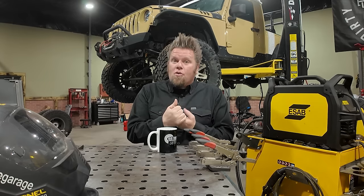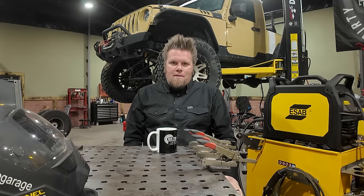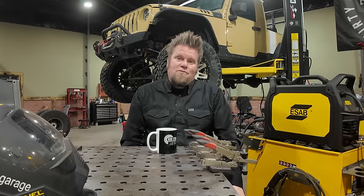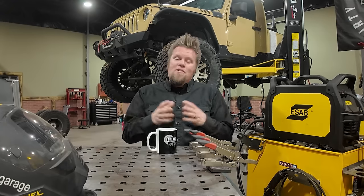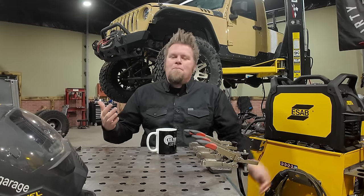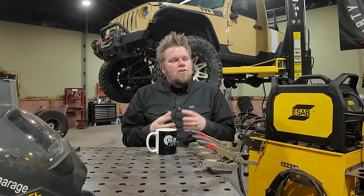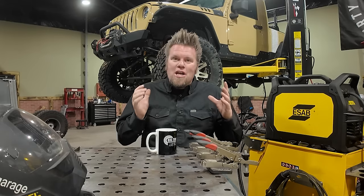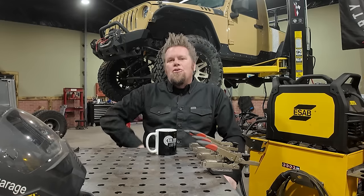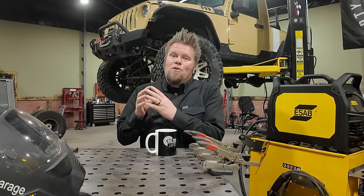Is your steering correct for a one-ton swap, or do you need to completely upgrade all the steering in your Jeep now? Obviously, you're gonna need new drive shafts at that point, so now you gotta get all new drive shafts for the vehicle. And then add to the fact that now that you've got one-tons, you're losing a little bit of ground clearance, you're probably gonna want larger tires, and then probably the most important thing is when you do that one-ton swap, those wheels that you already bought for your Jeep that you're in love with, guess what? They're not gonna fit on those one-ton axles. You gotta get all new wheels for your rig. Those are the additional expenses that people sometimes don't look at.